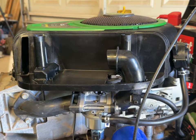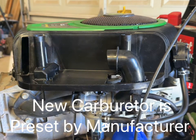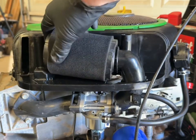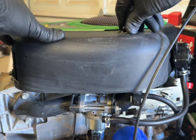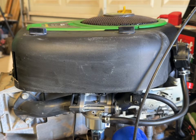At this time you can either try starting your motor to see if the carburetor fixed your problem, or since it's a new carburetor it should be calibrated and ready to go with no adjustments needed. Go ahead and install the air cleaner and then the air cleaner cover. Hopefully this video helped you on changing out a carburetor on a John Deere Briggs and Stratton engine. Please subscribe and like — I've got a ton of videos coming up and I'll see you on the next one.